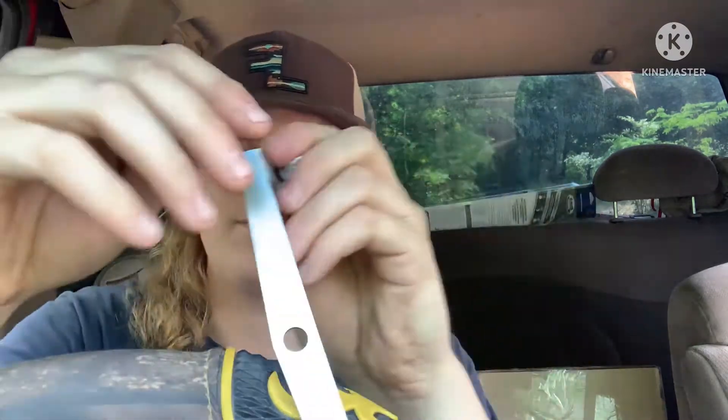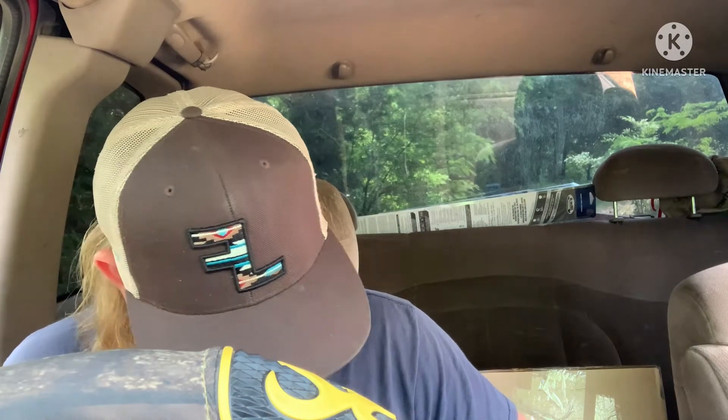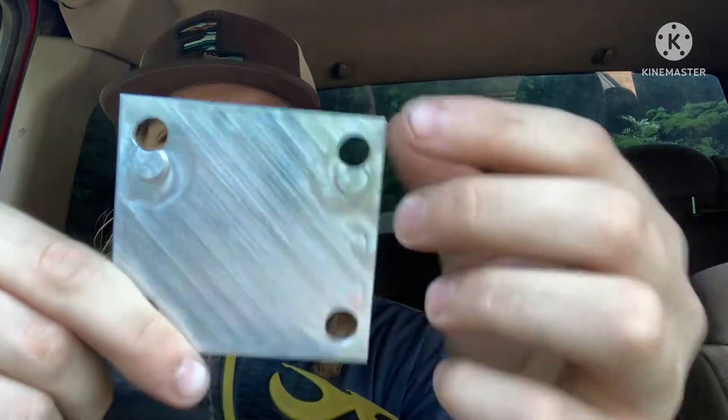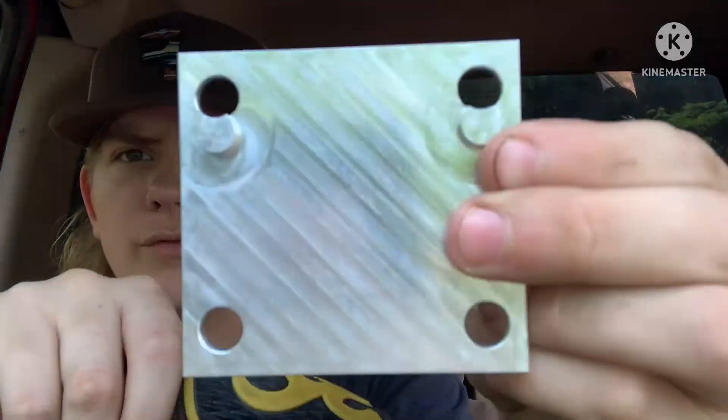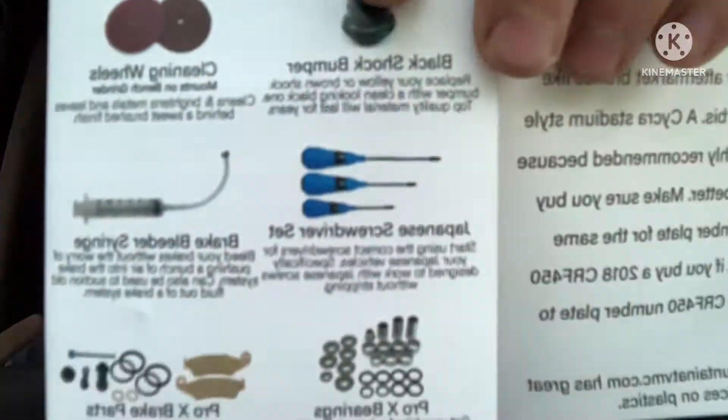Thank you. Alright, let's get into the actual restyle kit itself — how does this work? The restyle kit comes with a mount that mounts to your original bolt hole right there in the middle, and it has the hardware on the side that mounts your number plate. They give you a template — it's made out of metal so you can use it, it used to be paper. It's got these little things you put into your original holes, and then you drill out all four holes. Drill out those four holes and that's what makes your front fender fit and line up. They sell all kinds of stuff — I'll put the link in the description.